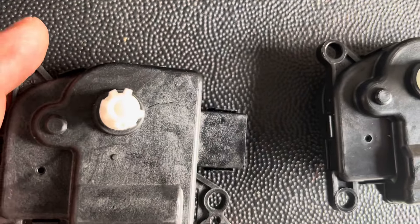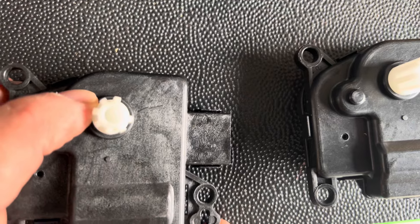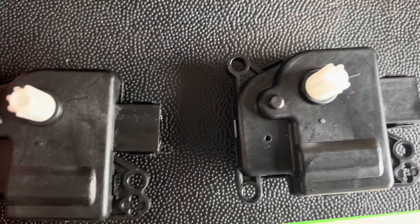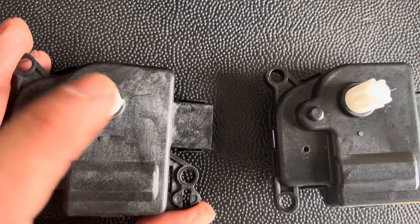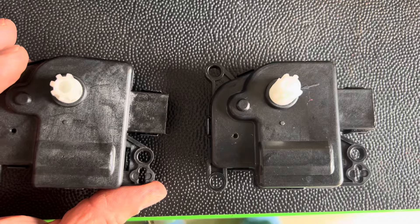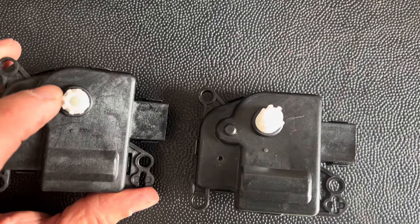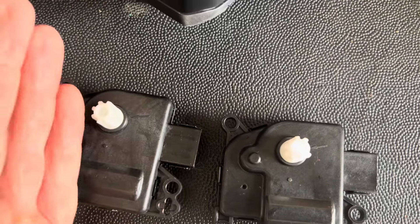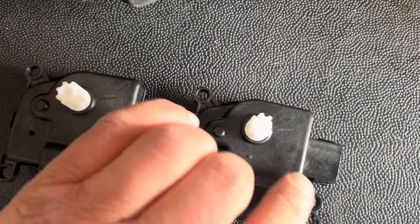The one I took out was off. So I put the actuator back in the truck and put the setting on floor, and it lined up with the arrow perfectly. You can't really rotate this by hand, and I didn't want to put a screwdriver into the housing to spin it. So the easiest way is to just put it back in without bolting it, connect the wire, hold it in with your hand, then put it on the floor setting — it should line up with that arrow.